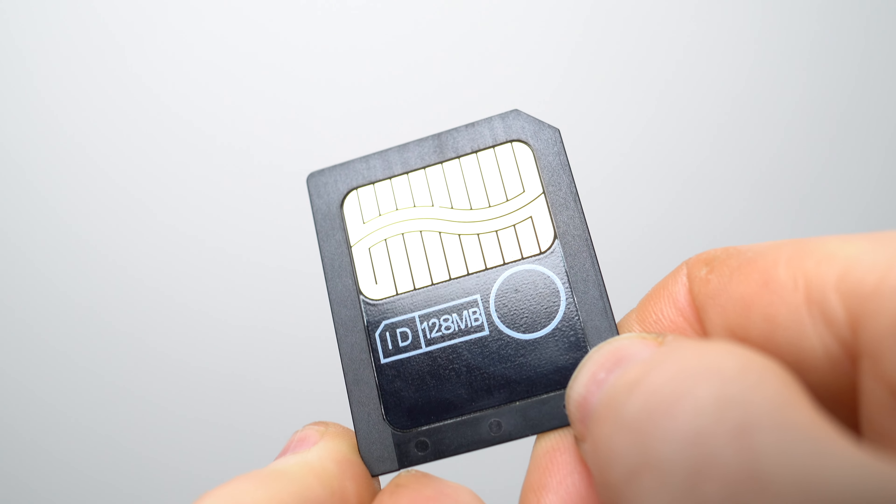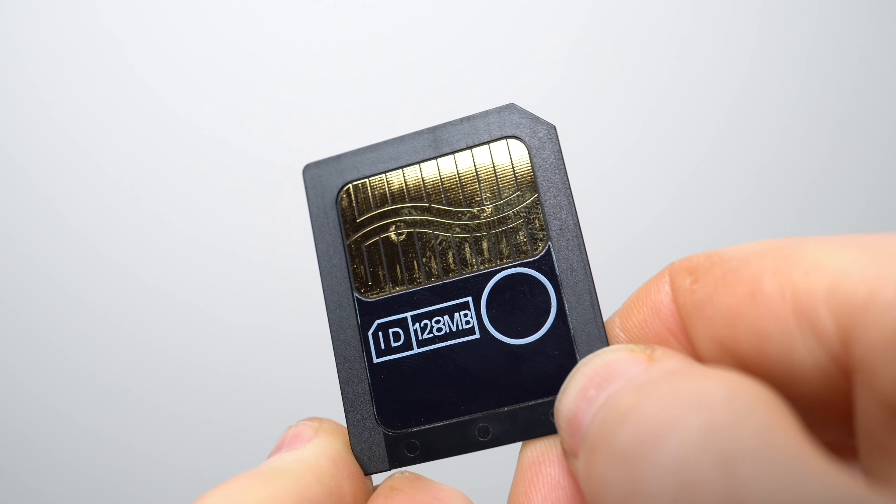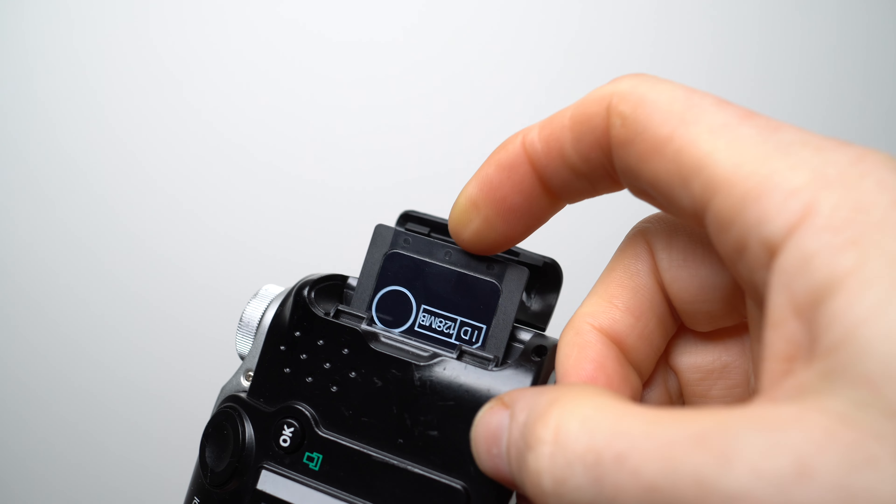SD and XD took their place before SD dominated completely. Today the use of SmartMedia cards is going to be a bit of a challenge — my antique rescue camera didn't come with one, but I did have an old Jessops card in my collection, fortuitously at the maximum 128MB capacity, allowing me to squeeze in over 100 best-quality SHQ JPEGs. If you have to buy a SmartMedia card, they typically cost around a pound or dollar per megabyte, and beware that they came in two incompatible versions: the oldest 5V cards have their diagonal notch on the top left corner, while the newer 3.3V cards have the notch on the top right. The C2000Z takes the newer 3.3V cards only.